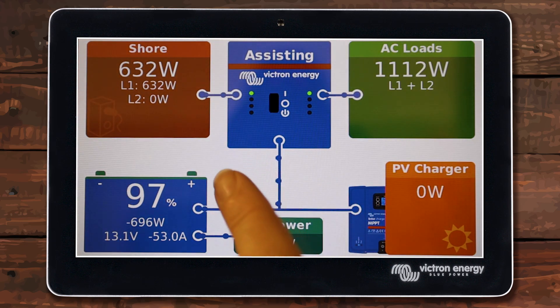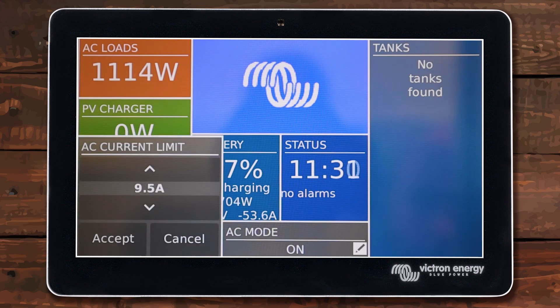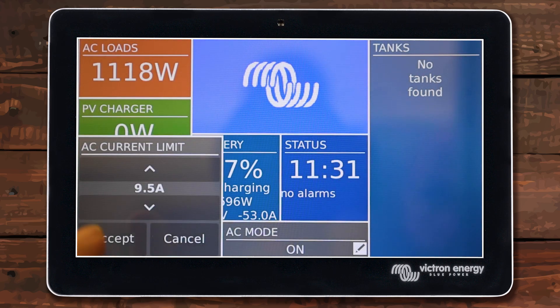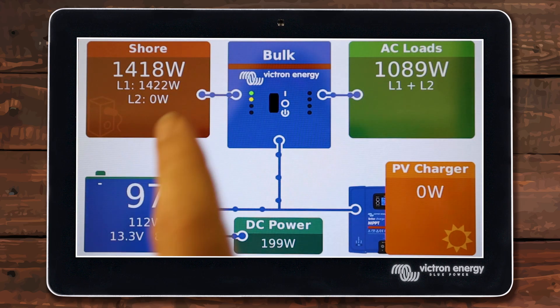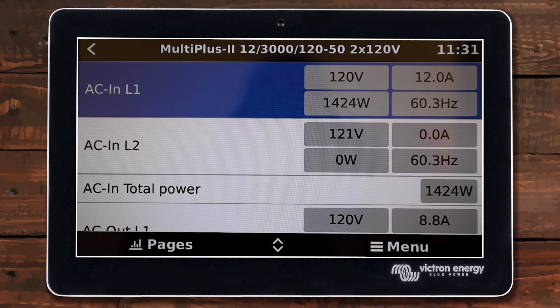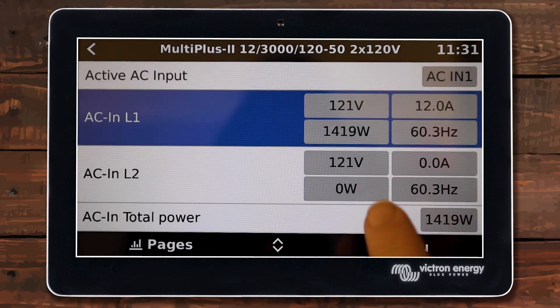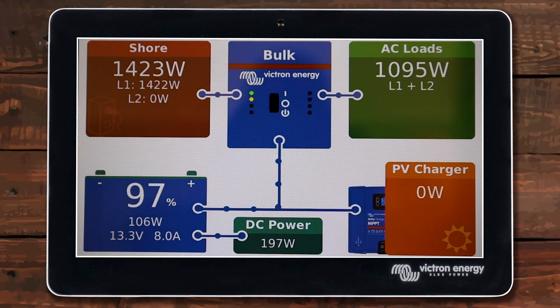I want to point out that I've had someone who had this set really low, forgot about it, then plugged into a 50 amp outlet and didn't change it to a higher number. What happened was their inverter was trying to assist even though it didn't need to because they never corrected the current limit. So go ahead and put this to what you're actually plugging into — it can be lower but it's best to set it just 2 amps below whatever you're plugged into. As soon as I put this back up, the inverter can pull more power and it's now charging the batteries back up. This information can also be found in the actual inverter menu.